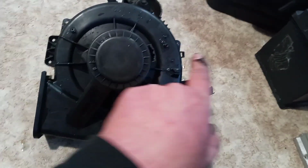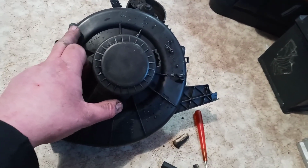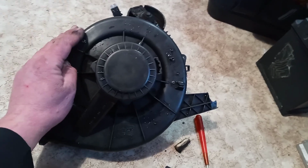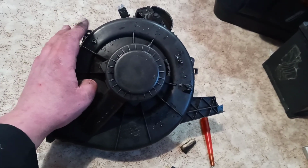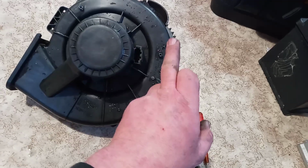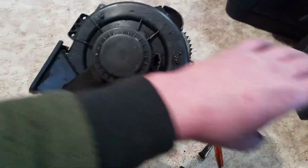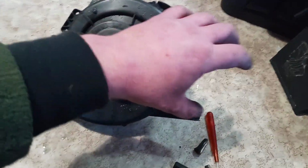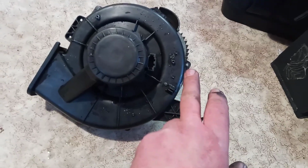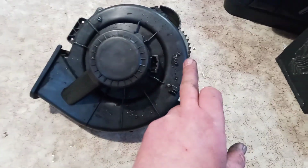And these upper ones, particularly both of these, are possible to remove with the Torx 15 ratchet, and you can push your hand into this limited space, but it is impossible here. So there is a mounting hole or service hole right in the middle of the aluminium profile, which is part of the body or part of the dashboard. So definitely it is not needed to remove the dashboard to remove the fan. You must only find the proper hole.